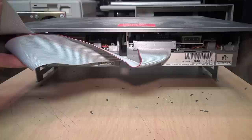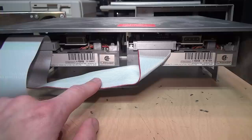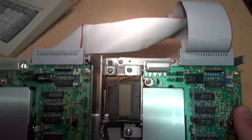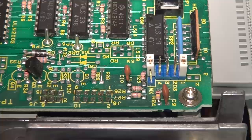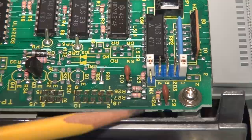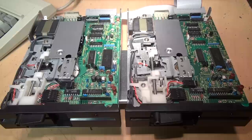Here are the two floppy drives — they were made by Matsushita, in other words Panasonic. You can replace these with 3.5-inch floppy drives, but since the onboard controller does not support high density, those will only be usable as 720K double-density drives. Speaking of the floppy drives, you'll notice there is no twist in the cable between the A and B drives, unlike the IBM PC and most other PC clones. Instead, Zenith followed the original Shugart floppy drive interface design, which uses drive select jumpers to determine which drive is A and which is B.